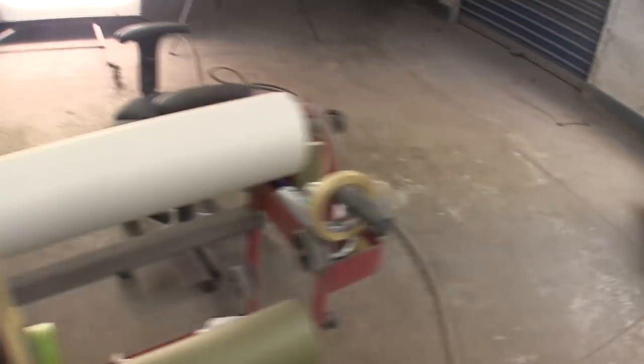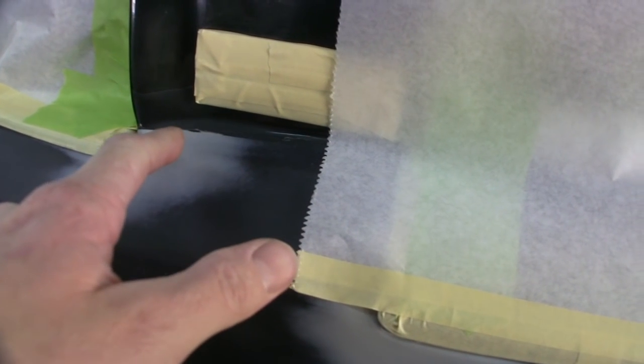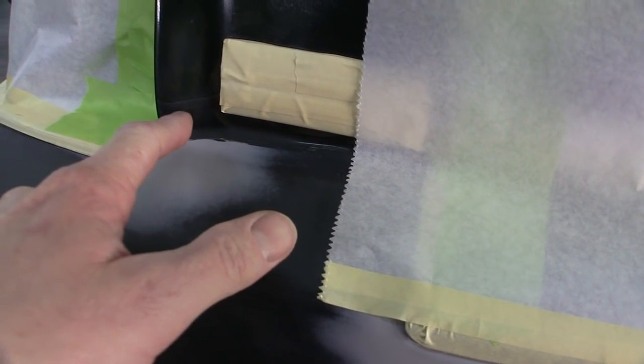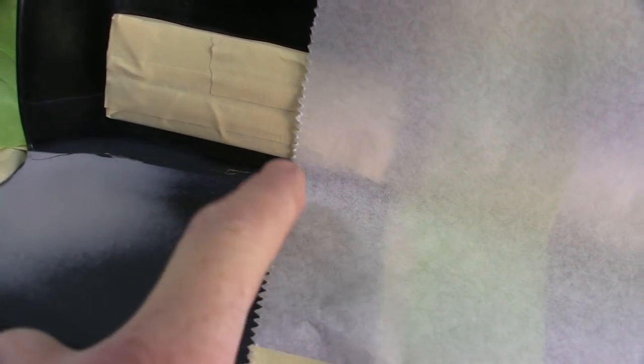It's already been cleared. Look at that — doesn't that look like garbage up there? This may have had solvent melt repairs on it before, again not by me. The only one I ever did was right here and you can't even tell. The other place we're going to melt it — somebody's got a tape line in it there, and there. I melted it somewhere in the middle last time. This is just piss poor right here as well as right there. You can see the white line on top, and it's been solvent melted way up into here — you can see it's all dull, got spots in it. I can see a fisheye they painted over right there.